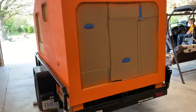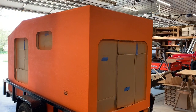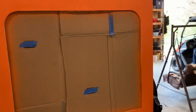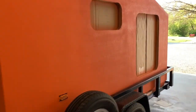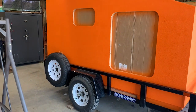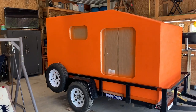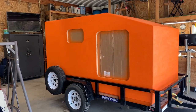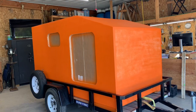The bottom shouldn't see nearly as much weather as the sides and the top. The back and the driver's side has two coats. The front and the top have one coat — that's as far as eight bottles got me. Now, if you're thinking of doing this yourself on your camper, remember that this one's 10 feet long and five feet tall, and I also lined the bottom. It took me two bottles to do the bottom with two coats. So if you have a more traditional sized teardrop, the eight bottle system would easily do that. I have a lot of surface area to cover.